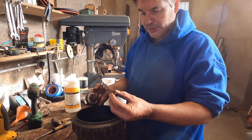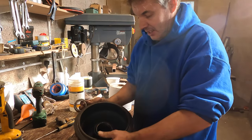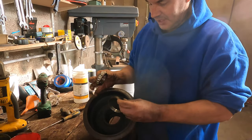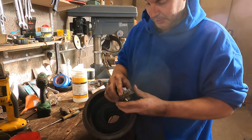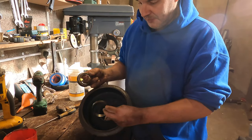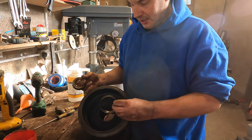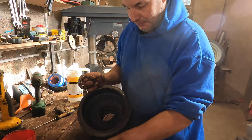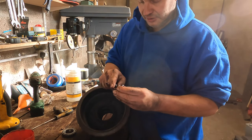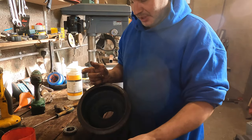So it's the first time we've replaced bearings on a wheel hub. We found out eventually that these are separate — obviously it's a tapered roller bearing. They go in first, then your bearing goes in. I had to get a punch and punch these out from the underside. The bearings weren't so bad, but on this one — whether it's because of the copper grease or whatever's wrong with it — that one fell to bits.